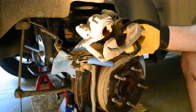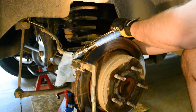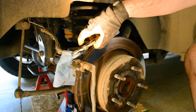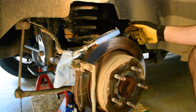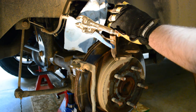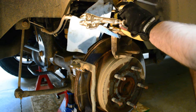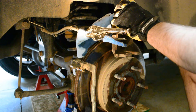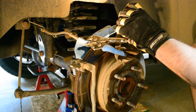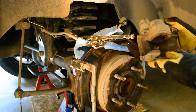As you can see it's kind of chewed up there a little bit, so I'm going to get this off and rebuild it. I'm not going to go through how I got the brakes apart because I have a different video for that. So instead I'll jump straight into this. The first thing I did was crimp off the brake line so I don't get more fluid coming out than I need. Next I'm going to take this part off with a 16 or 15 mil. That just comes right off. Be careful not to lose this little crush washer here - we're going to need that.